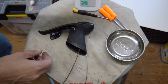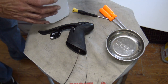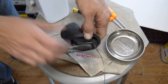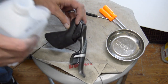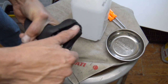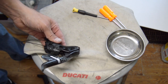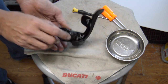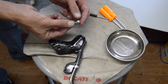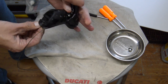To disassemble this shifter we're going to need a few things: a small Phillips screwdriver, a couple picks, and some isopropyl alcohol. I'm using 70% isopropyl — usually I like 90% or denatured alcohol. Pour a little bit in between, give it a little twist and it'll come right off. We want to pull this out so it doesn't get lost — there's the little bolt that secures it to the handlebar clamp and there's a little washer with a little lip on it.